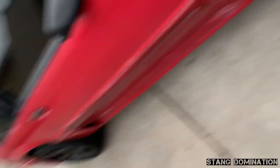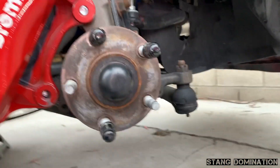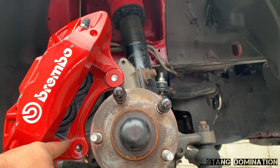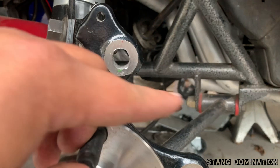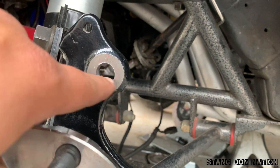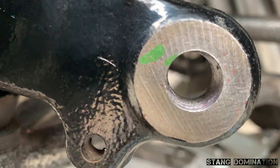Look — I can't go up anymore, and look at the bolt: you can't see the threads on the bottom part but you can see the threads on the top. I'm going to recommend drilling the bottom part toward the top bolt. The wheel spins this way, so if a bolt ever comes loose and snaps, you want the bottom one to hold it. I'll use grade 8 bolts with lock washers and probably some Loctite. You can see the oval shape on the top hole versus the straight circle on the bottom. I drilled half inch first, then 9/16ths, then dremeled, and followed my markings — spot on.